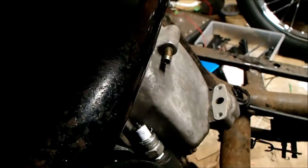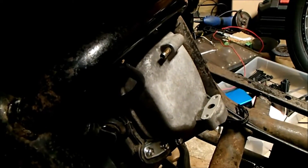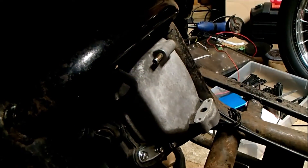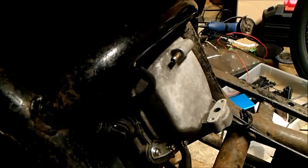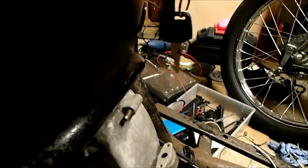It must be something else — possibly fuel. The problem was, as I suspected, a fueling issue. To fill the carburettor you need a vacuum to open the petcock, and it's a very slow process. So if the carburettor has dried out completely it takes a while for the float bowl to fill up. Whilst cranking the vacuum is very low. Remember to turn the ignition on!